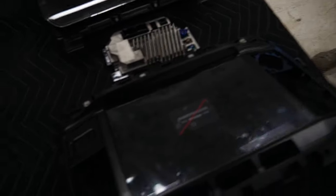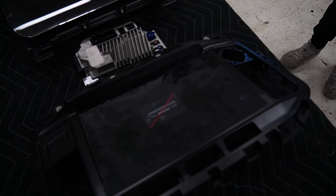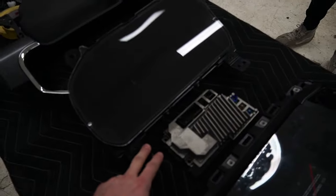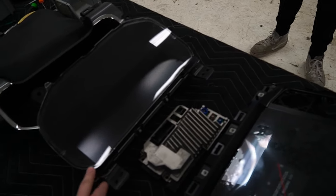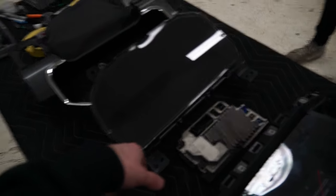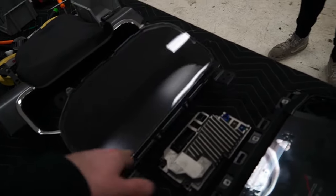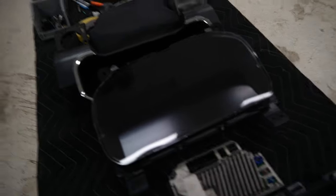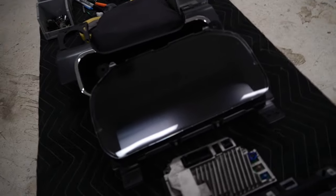It's a fairly simple install. You will need a wiring harness in order to install the screen into the new APIM. You don't need a wiring harness for the digital speedometer cluster, but if you buy it new, you will need to recalibrate your mileage to this digital cluster. Because if it's new, it's going to have zero miles on it, and if your truck has 5,000 miles you'll want to correct that. You'll have to send that out to somebody that can do that — we don't do that, don't ask us.